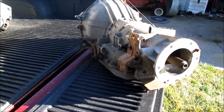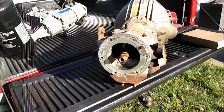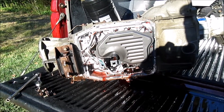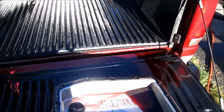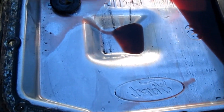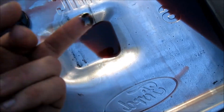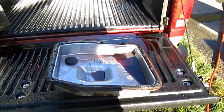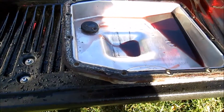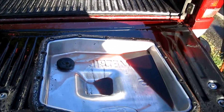I'll bring you guys back once I've got the transmission hosed down and the pan pulled off, and we'll change out that filter and gasket and have a look at what everything looks like. Alrighty, we got our trans all cleaned up and the pan pulled off — made a huge crime scene on the back of the truck with ATF, but I'll be able to clean that up. The pan looks beautiful inside — not much on the magnet at all, just a little bit of material which is pretty normal. This is a reusable gasket, probably an OEM Ford gasket, so we're going to clean it up, put the new filter on, and button her back up.